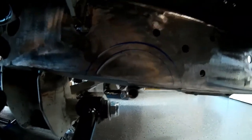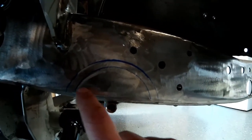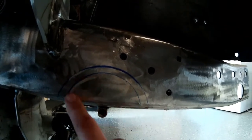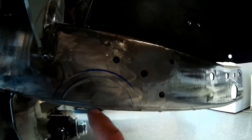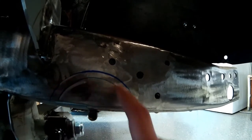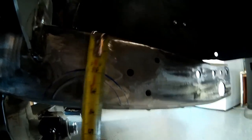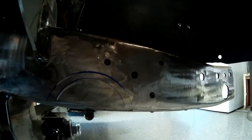So I thought I'd show you guys the reference marks here that I put on the frame. I chucked up the hole saw and just did a slight cut here so I could check the radius that's going to be cut into our frame rail. As you can see, the three and a half is just too small - it's an inch and three quarter from the drill guide to the outer diameter, as it should be. The four and three eighths is just going to work much better for us, so that's what I'm going to go with. The overall frame height at this location is four inches and my cut is a little under two, so I think that's perfect and acceptable.